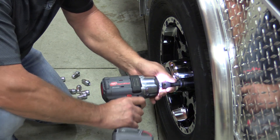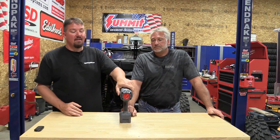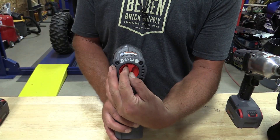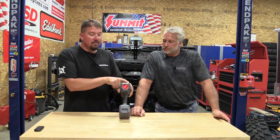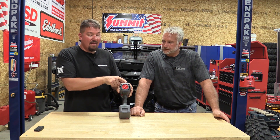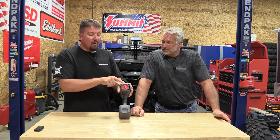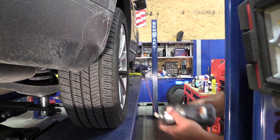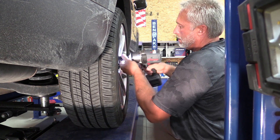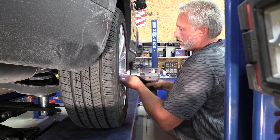What I really dig about this unit right off the bat is that it's simple. When you turn it around to the back, you have a very easy way of adjusting everything. They have a full circle painted white for full power, a circle painted half-white half-gray for half power, and a wrench-on-a-nut icon for wrench-tight. Depending on what nut you're using, that's going to be anywhere from 35 to 110 foot-pounds. You still have to use a little common sense — it automatically shuts off when you let it go.